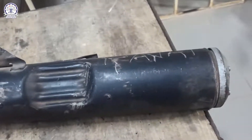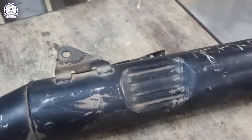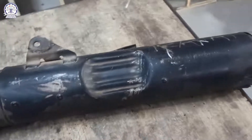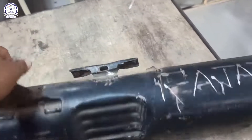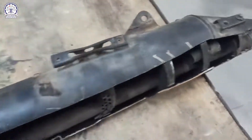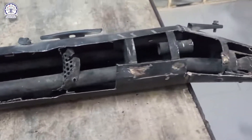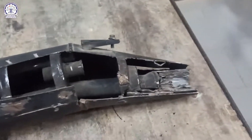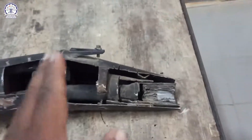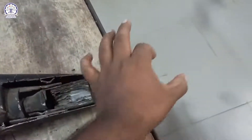We are going to see how exactly a silencer does its job and what is present inside a silencer. To show you what is inside, we have to cut the silencer open, and I have done that for you. We will see the internal parts of a silencer and have a look at what the internals are made like. Let's first have a look from the front — this is the front section of the silencer, which connects to the exhaust manifold of your engine.